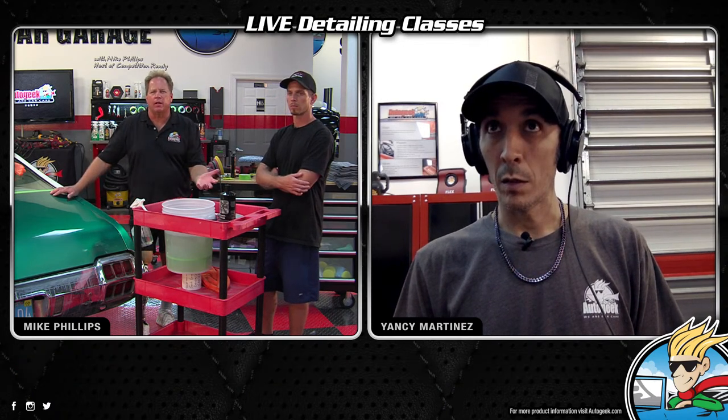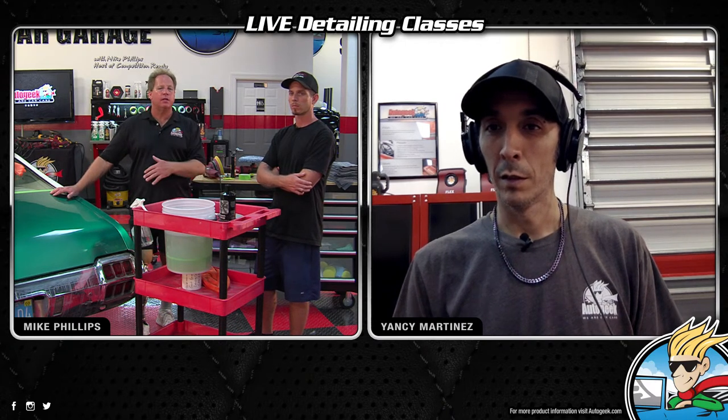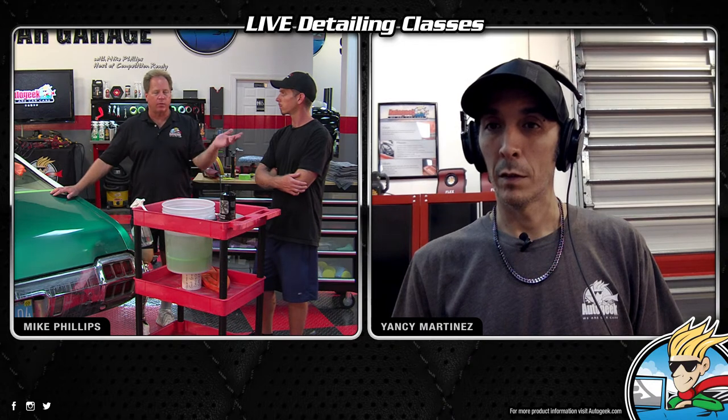Okay, moving on. David, you just mentioned new paint. How long should you wait before ceramic coating freshly painted paint? Well, there's no paint manufacturer that I know of that recommends sealing paint until at least 30 days go by for outgassing. So 30 days. I always say, what's the hurry? Wait 30 days. If you just got your car painted, wait 30 days, then wax it, put a coating on it, whatever you want to.